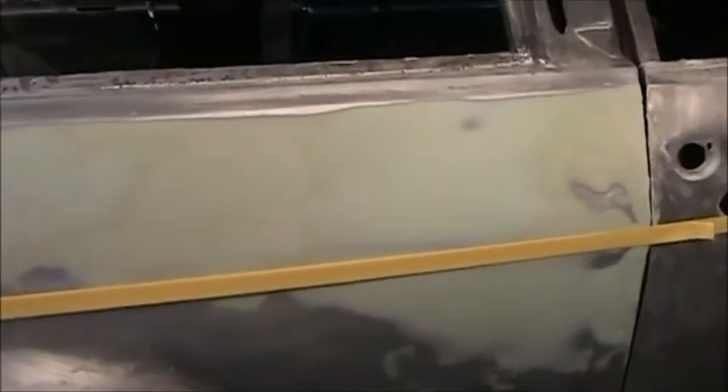Other than that, this feels pretty good until you get there, which I haven't done too much on the top of the body line — the quarter. Anyways, I just thought I'd show you what I'm going to try here. We'll mix up some body filler, see if I can get some more in there and hit it with 40 grit first, try to get my shape. Now I can really see where I actually need extra. I'll be back.